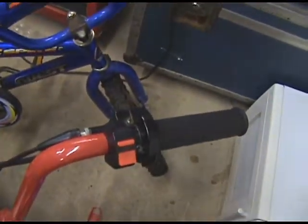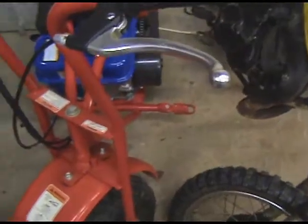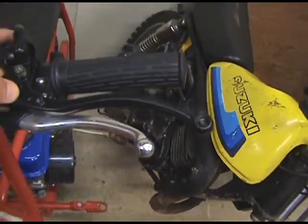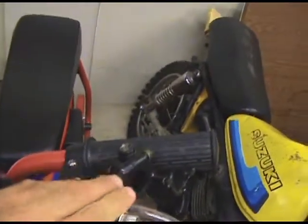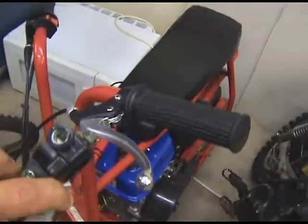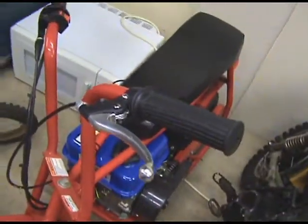The throttle, other than the grip style, is identical to the one here on the Doodle Beast. And the kill switch too. The brake lever is actually slightly different — it's actually bigger, and the lever is actually black, where the original lever here is unpainted aluminum. This one is all cast aluminum. The way it looks, it looks like it's for the right side, which is fine. And you can put a mirror on it too. Interesting. Pretty cool. These were advertised as DB30 twist kits.